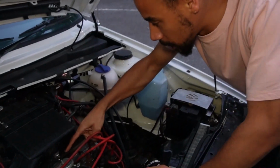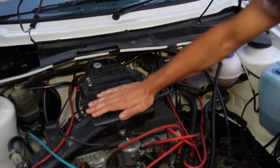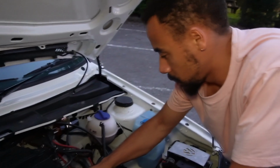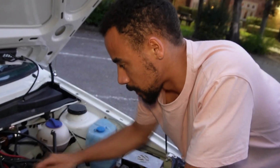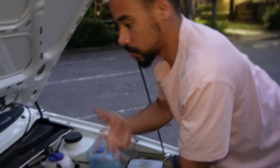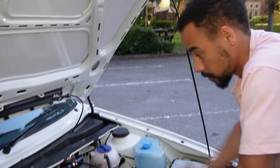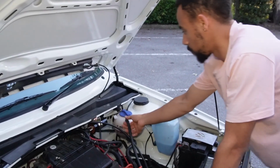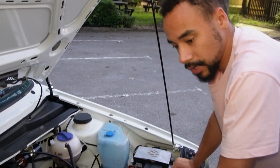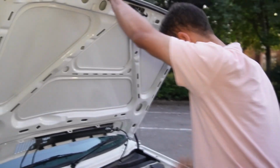This bolt here, while I was messing around with it, was stripped, so it wasn't being pushed down. It's not doing a very good job at the minute, but they completely cross-threaded it, so I ran a helicoil through it and that's all good now. It's just little things like that, where someone's bodged it together just to get it working, but not thought that someone else has got to go in there and is going to want to fix it. So this is the kind of stuff we're up against. It's a 32-year-old car and it's had 11 owners, so at some point there's going to be a lot of bodgeries and problems we've got to fix.